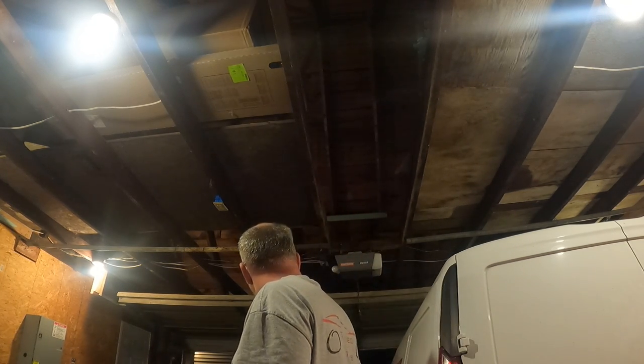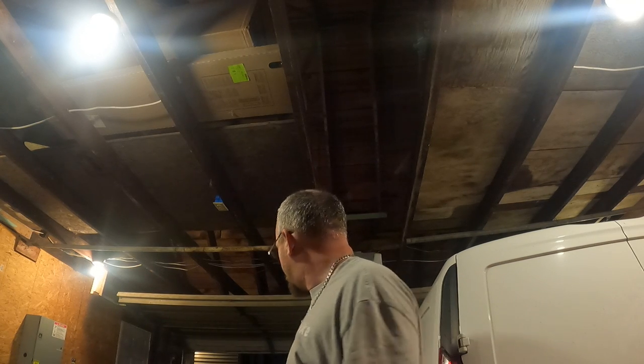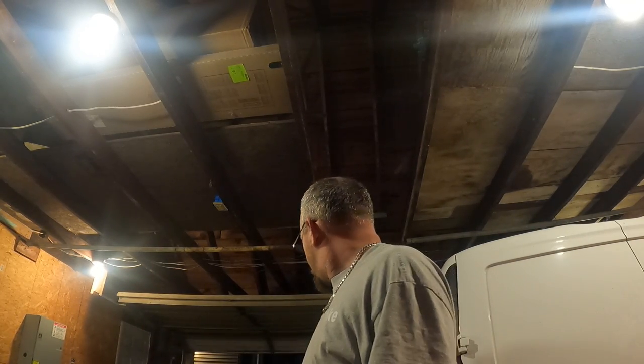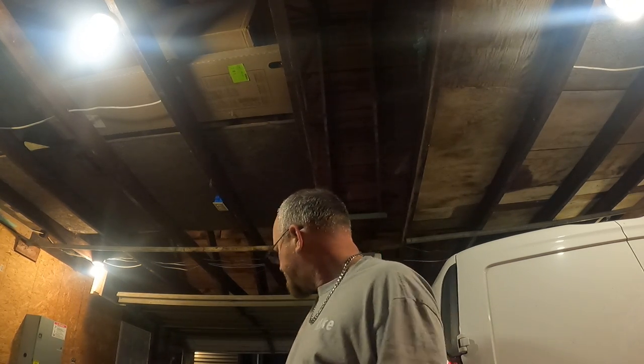But yeah, I'm going to go ahead and do this. Not much to these. Pull that bumper off, a few bolts, that bumper cover comes off. If it's got fog lights like this one does, unplug each side. That's just a little 2-pin connector. The little tabs are on the side, pops off easy. Then take out the condenser, make sure you've had it evac'd already.